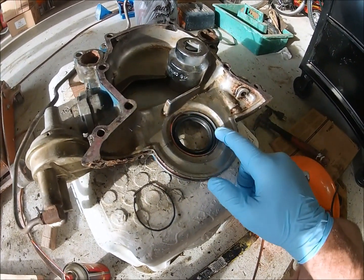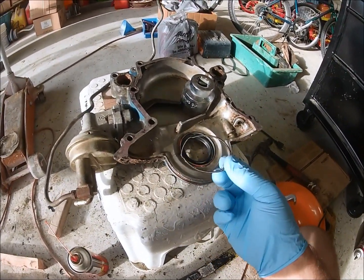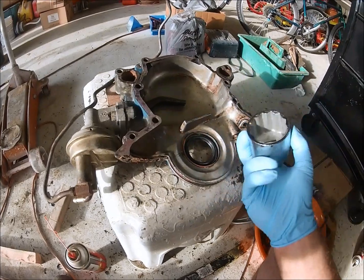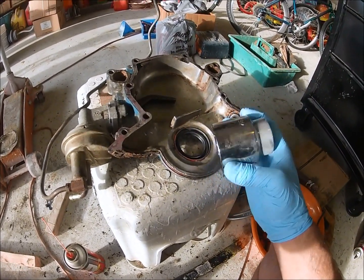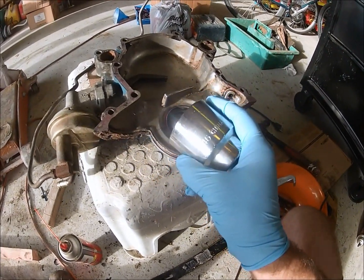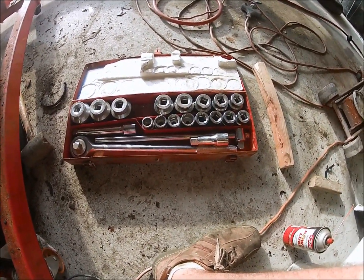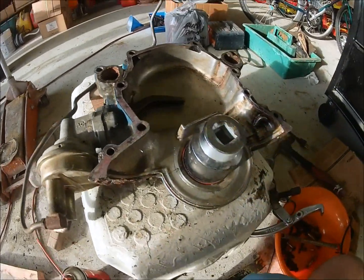What I've done is remove the wire ring — otherwise you can smash it and have to go get a new seal. Take that wire ring out, then use a socket to install it. This one is a size 46 from Harbor Freight; it came with a set and fits perfectly in there.